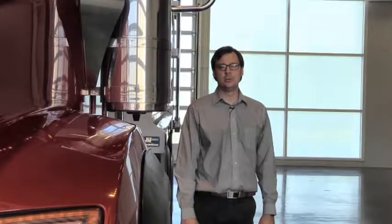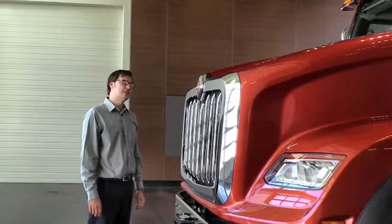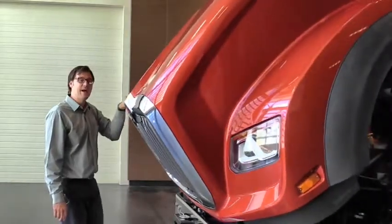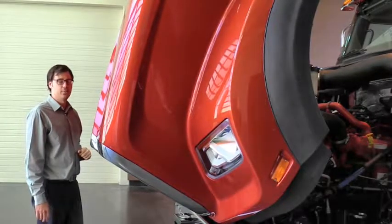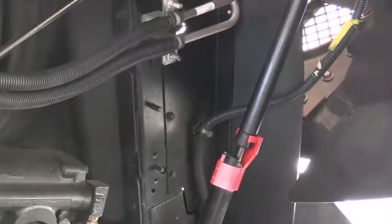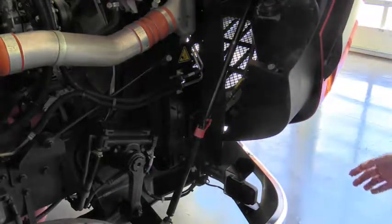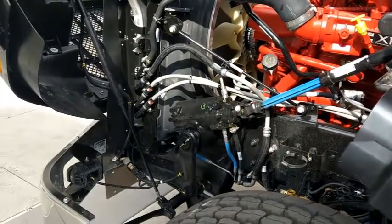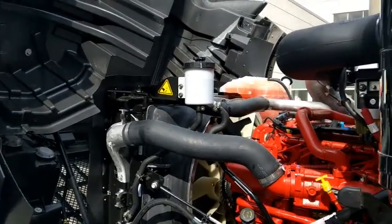When we talk about driver first at International, we tried to think of all the ways that you use your truck and how to make that experience better — from ease of operation all the way down to your daily service checks. The effort required to raise the hood on this HX is best in class at 31 and a half pounds, compared to competitors where it can take over 70 pounds. This model features hood blowdown protection, which keeps the hood locked in the open position until it is unlocked. The grille and splash panels are attached and move up and out of the way for service convenience — standard on the 520, 615, and 620. Together with the easy and wide hood tilt, you get great access into the engine compartment for quick and easy maintenance. It's all about uptime with HX.